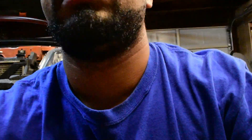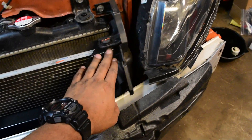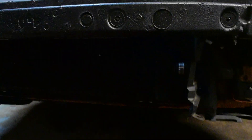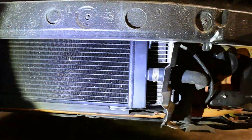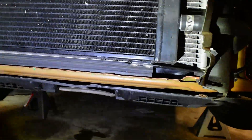If you look at the car the way it is now — the bumper is off. If you look at these brackets here, these are the brackets that hold the after-cooler radiator, or heat exchanger really. This is actually the heat exchanger itself. This line feeds to or from the heat exchanger inside the intake manifold, and the pump basically circulates water through the system. It's a pretty clean setup — you would even think it's OEM.